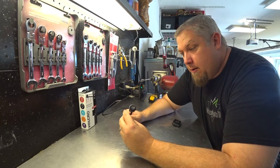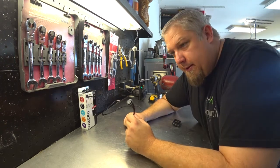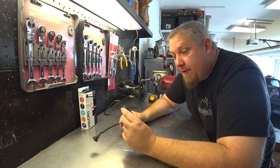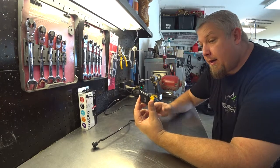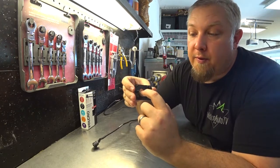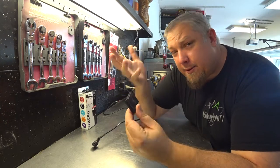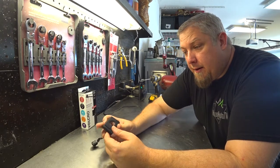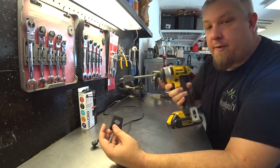So I was looking at my dash, thinking about where I was going to put it, but the third gen Camaro came with this empty faceplate on the actual bezel that goes around my dash. So I was thinking, well, huh, we'll just use this. Obviously it didn't come with a hole in it, but I put this hole in there using a drill bit. I marked the middle and the back with a small drill bit, and I drilled a hole in it this way. I wasn't sure if this was gonna work, so I didn't really video it, but I put that hole in there first. And then coming from the face, I didn't want to mar it up or scratch it, I used a 3/4 paddle bit,